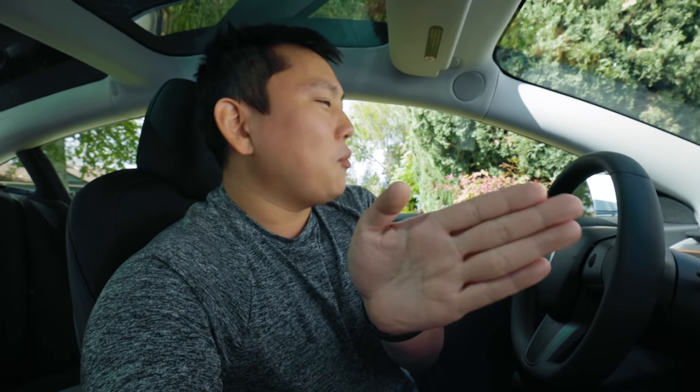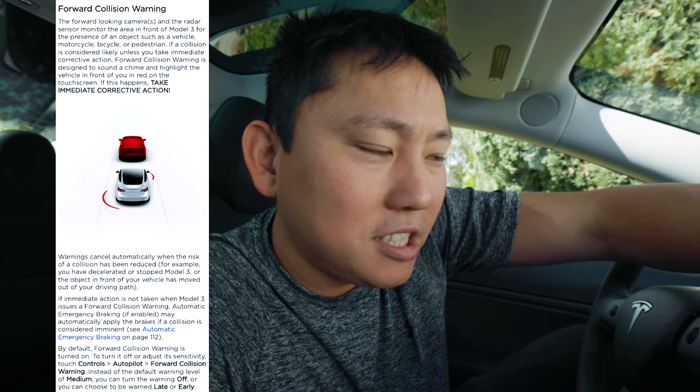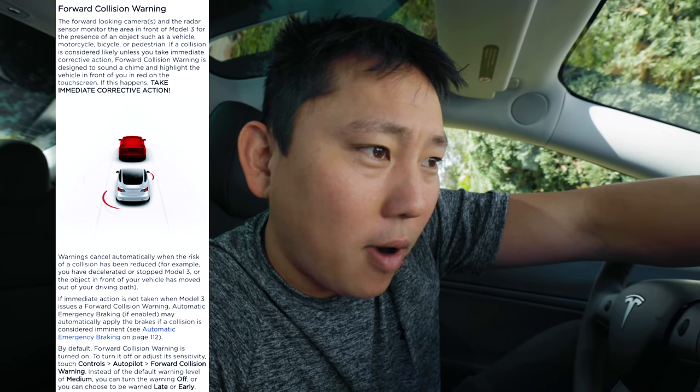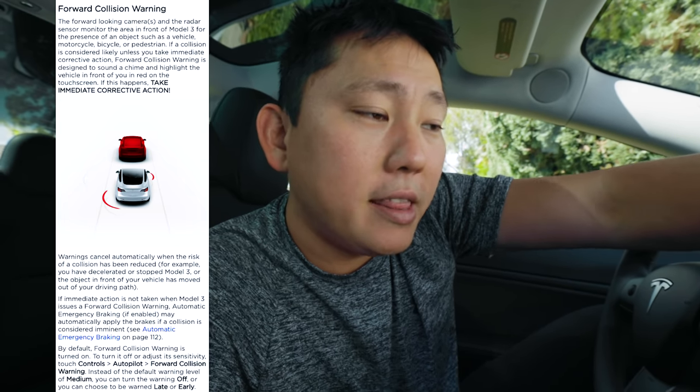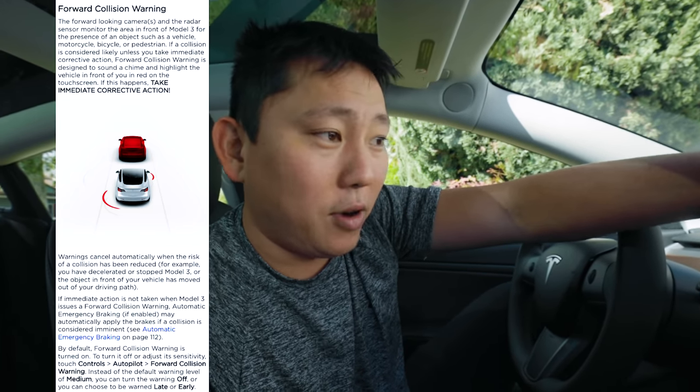The car also accounts for adjacent lane speed. If the lane next to you is going significantly slower, it's not a good idea to go fast — if someone merges out, you won't have time to respond. The car will adjust accordingly, but you can always override by pressing the accelerator pedal. There are plenty of warnings that this is just an assistance tool — you're still responsible for checking your own blind spot. There's also forward collision warning: the forward-looking cameras constantly monitor for cars, motorcycles, bicycles, or pedestrians. If automatic emergency braking is enabled, it will automatically slam on the brakes so you don't hit whatever's in front of you. The emergency brake does not apply when you turn the steering wheel sharply, accelerate hard while braking is being applied, or press and release the brake pedal during the braking event.